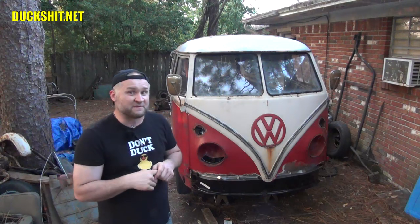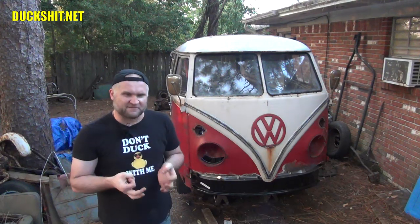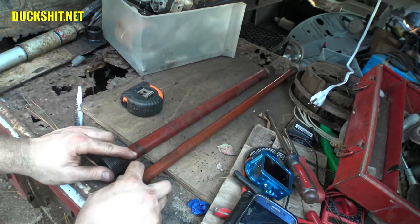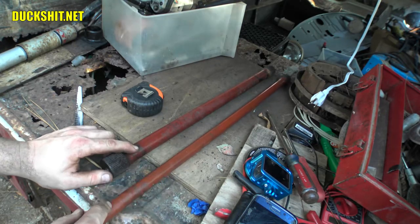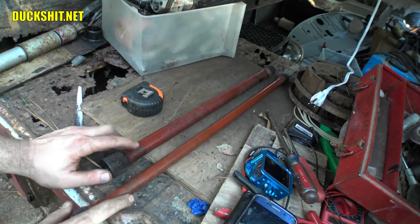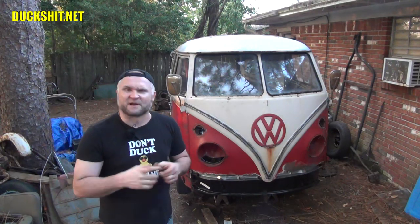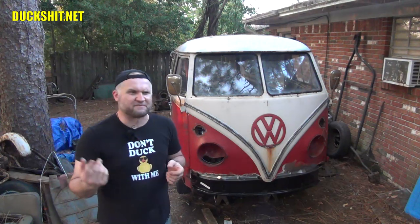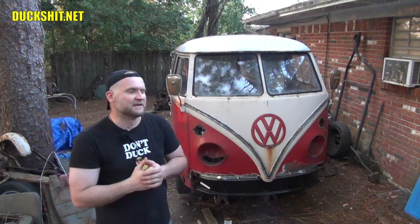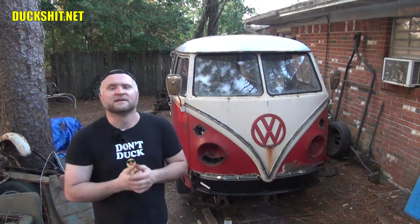The fastback will also be upgraded sometime this winter — I've got all the parts for that sorted out too. Today I just picked up some new torsion bars for it — some heavier gauge ones from a squareback. Why did the squareback get heavier ones? Because the squareback is intended for heavier payloads, so they had a stiffer setup because it's going to be supporting more weight. I like vehicles to feel a little more sporty, so I figured squareback torsion bars would work really nicely in the fastback. By the way, they're the same torsion bars that are in an early 924 or 944 — 23.5 millimeters, whereas the fastback ones are 22. So it's subtle, but it will be a little bit stiffer and I think it'll give a nicer, sportier ride.